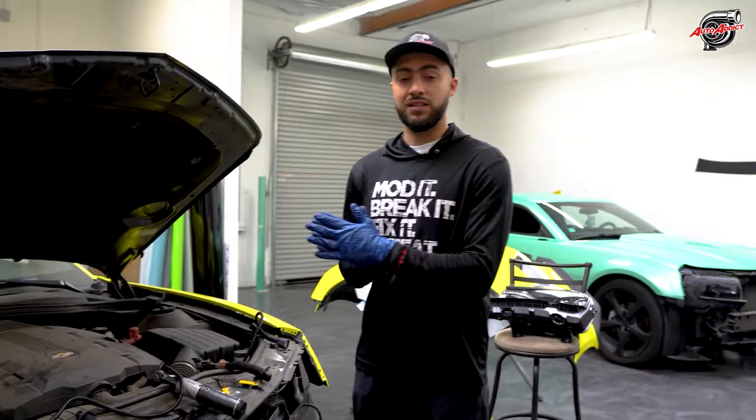All right, guys, so the first thing that I wanna do, which is the first mistake that a lot of our clients do, is the turn signal harness. Again, let's go back to the black Sharpie line that we marked here, indicating that this is our negative line, which is ground. We gotta look at the aftermarket headlight, and there is a white, black, yellow, black. So the two black lines are connected together. That's the side that's gonna go up. As you can see, the black line right here, it's gonna go in there, lines up with our Sharpie line that we marked for you guys.